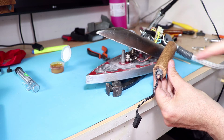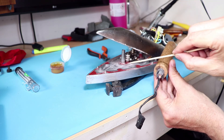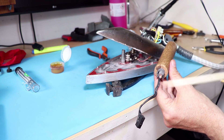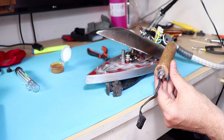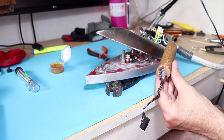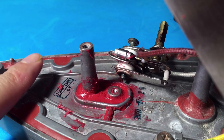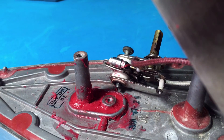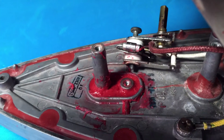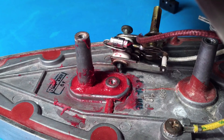The vapor is coming out of this red silicon, which is not good, and that's probably what caused the fuse to break. So I need to replace that red silicon with new silicone and make a nice seal so that the plate of the iron is sealed tight and this problem won't occur again. I've now replaced the silicone and it looks fine — there are no cracks and there should be no vapor coming out.